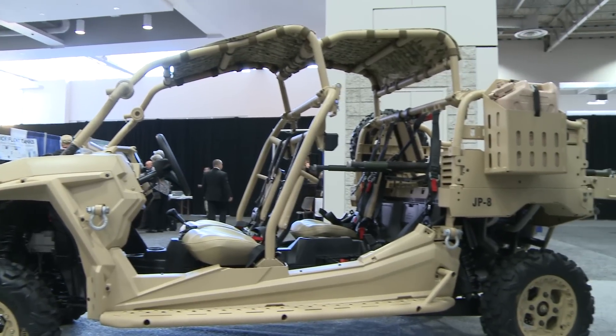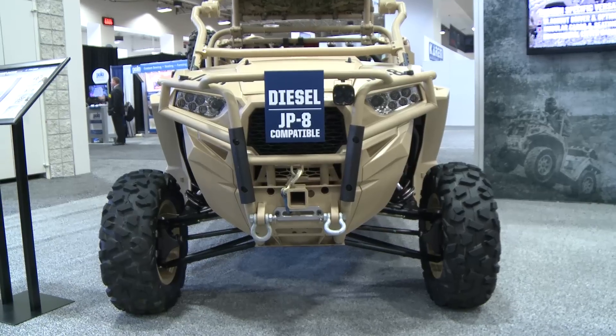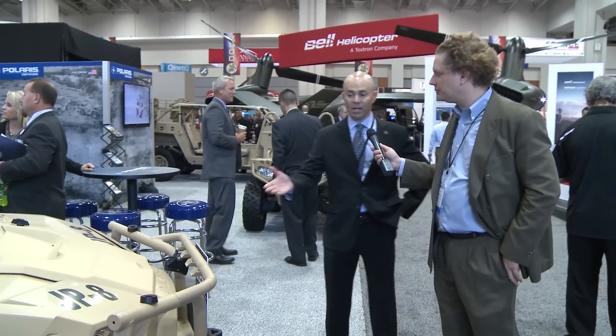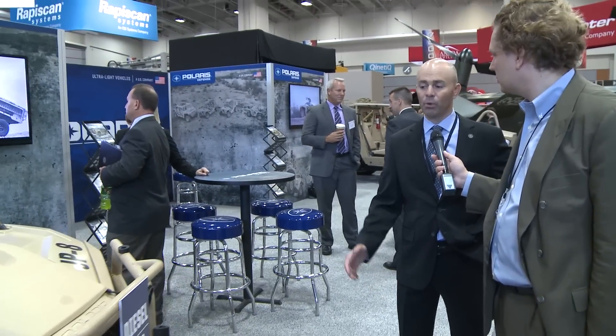Your new vehicle rolling out at this show is diesel-powered. Why is diesel a big deal? There are two defining characteristics — one is that it's now JP-8 or diesel capable. Heavy fuel enables you to go along with standard military forces deployed aboard airplanes and ships, using the same single fuel as all their other heavy vehicles. That makes it far more deployable and easy to support logistically. Also, unless you're getting waivers, you can't deploy gasoline-powered vehicles aboard ships or airplanes due to flammability, but with JP-8 fuel you can deploy far more vehicles in many different methods.